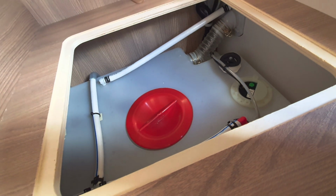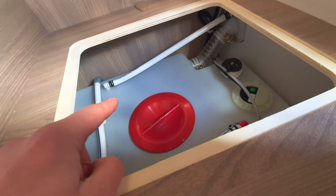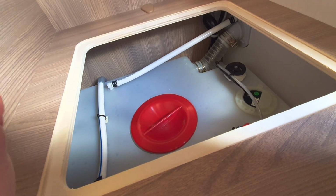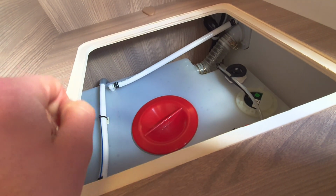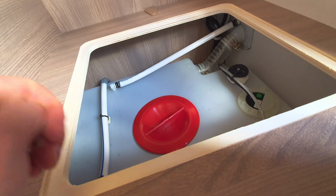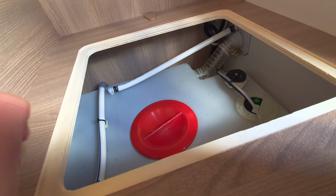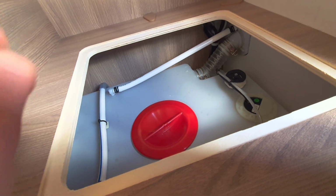You've got three main drain down points in the vehicle. You've got your freshwater drain down point, your wastewater drain down point, which is external to the van, and then your boiler drain down point, which is again, like the freshwater, internal to the van. They're all very important, and please ensure that when the vehicle is not in use, especially in the cooler climates, to drain them down.